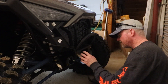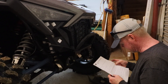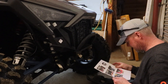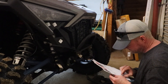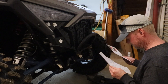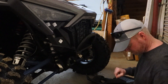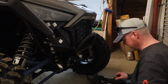So now we can take off the front bumper — I'm going to need some sockets for that. It looks like this mounts where this front bumper hoop used to be, so we're going to get that out. It looks like there's a front mounted bolt and then there's a through bolt at the back, so I may need to get some wrenches.